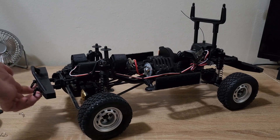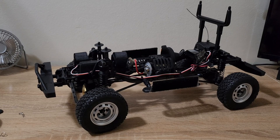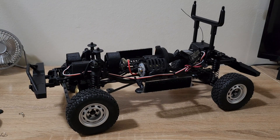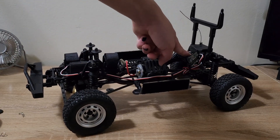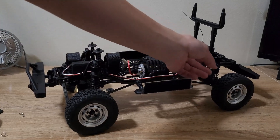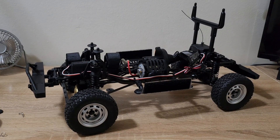Those are still complaints I had with the old version. I'll try to give them some slack because they are a much smaller company compared to Axial or Traxxas, but I think they definitely could have done better especially for the money you're paying. The other thing I had to deal with on the old version was they claimed it was waterproof, but it definitely was not — the ESC and receiver both died. This receiver box, they claim it's waterproof. It's not waterproof at all. We'll have to see if this new ESC is actually waterproof or not. Also the switch is just dangling here, which is strange.